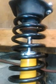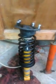I did have to buy new strut mounts up top. So for all you people who want to complain and say that there's no such thing as a strut on a Camaro, well, in the book it calls it a strut mount. That's what this piece right here is. You have the isolator up top. It's rusted in place. I let it soak all night long on PB juice. I filled this thing completely full and just let it soak, and it won't come off.